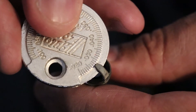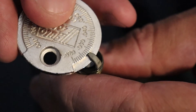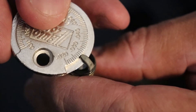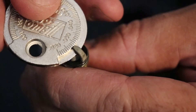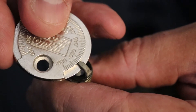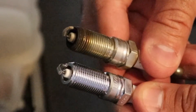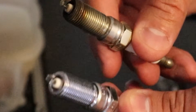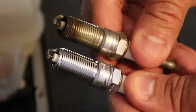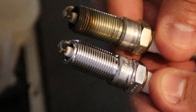The main thing I'm checking is whether the NGKs — gapped down from 0.041 to 0.028 — would drift back up after 5,000 miles, and in fact they did not. They're sitting right at 0.028 even after hard runs, dyno runs, and fine tuning. Here you can see the NGK I took out placed next to the new SP542 gapped at 0.028, side by side so you can spot any subtle differences.